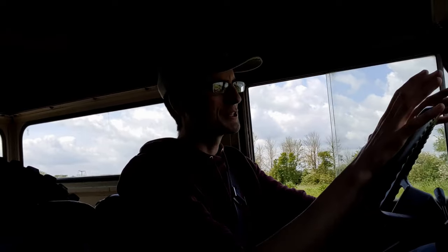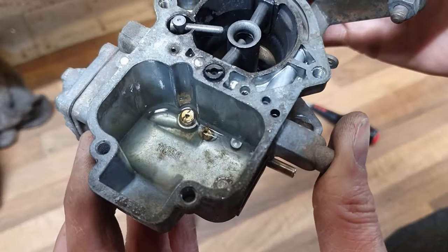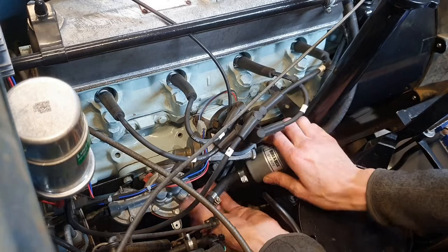I tell you what folks, we've done away with two odd noises. It's a sunny day and I'm having a lovely time driving this thing - it's just working beautifully. The hesitation that was there on my initial test drive, you might have seen it a few videos back - that's gone now. Cleaned the carburettor out again, put a new filter on it, and that's gone, it's beautiful. It's driving very nicely now even on light throttle loads. The steering's now straight - when the vehicle's going in a straight line, the steering wheel is straight. It is now mechanically absolutely sweet.